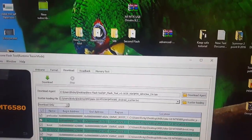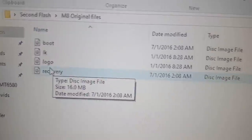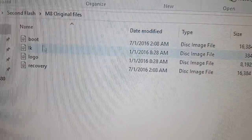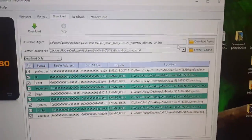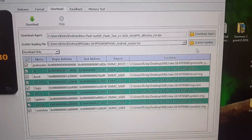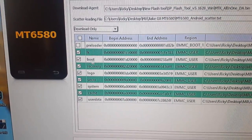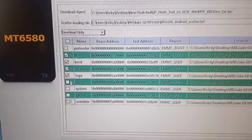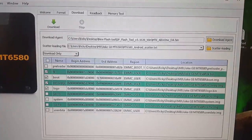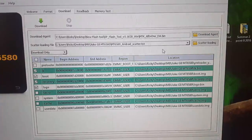Download the second set of flash files — there are going to be four files. I've extracted them here. There's a password for this file on the website. Take these four files — they are originally from the original phone. Go back to the tool and rerun it for a second time. The phone should be off. What you're going to do is deselect everything, and then select only these four specific files: one, two, three, four. Uncheck the others and check just these four.